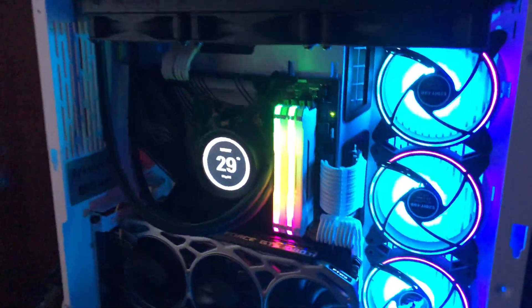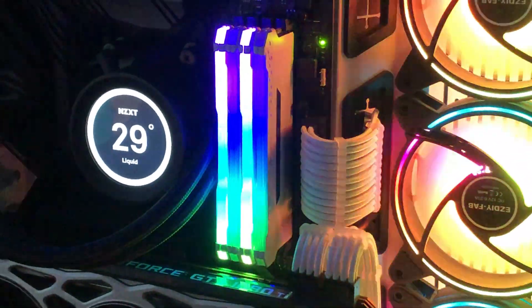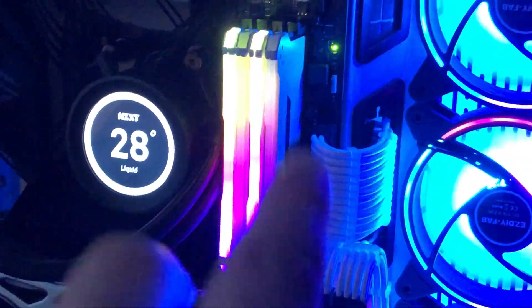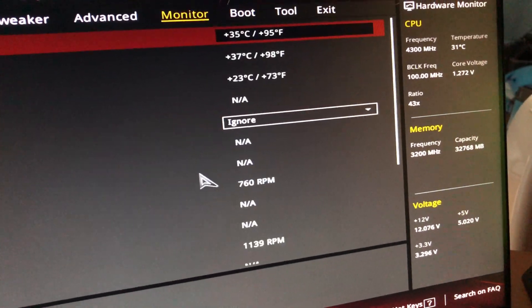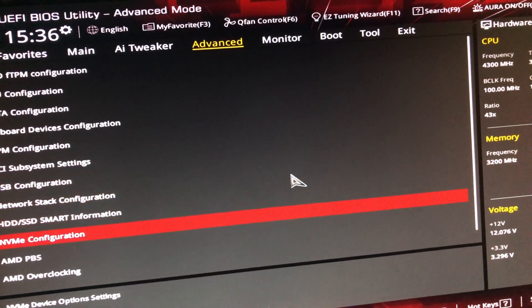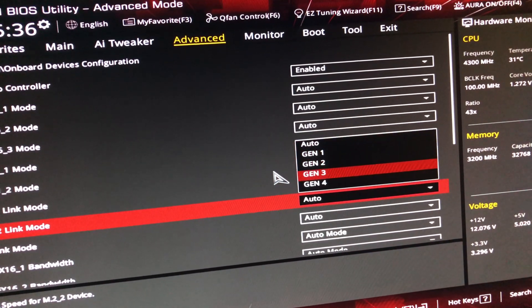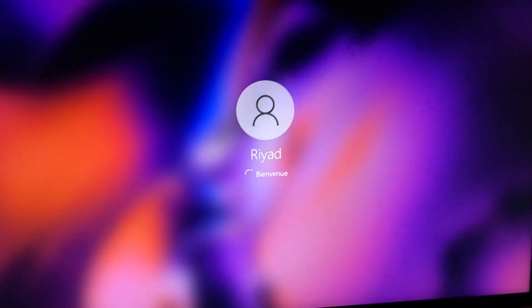As you can see, only two of the RAM sticks are lighting up — they're Corsair Vengeance lighting kits from Amazon. I have 32 gigs total. Going into BIOS to select the 980 Pro as the boot drive: Advanced, Onboard Device Configuration, Gen 4 for the first slot and Gen 3 for the second. Saving changes and resetting — and it's booting from the new SSD.